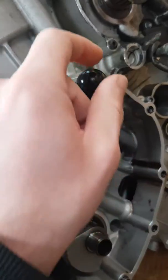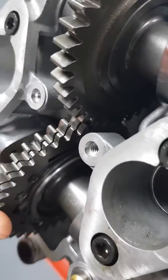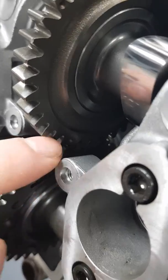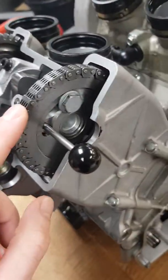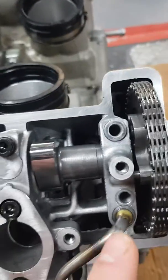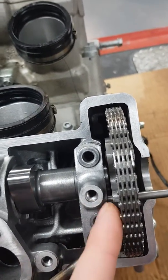There's a little notch in the crankshaft — once you screw it in it should lock the crankshaft. Once that's locked, you can then put your camshafts in with the alignment holes — the alignment punch marks, sorry. There's two on this sprocket and one on this sprocket. Line them up, then you can get your cam chain wheel onto your crankshaft.